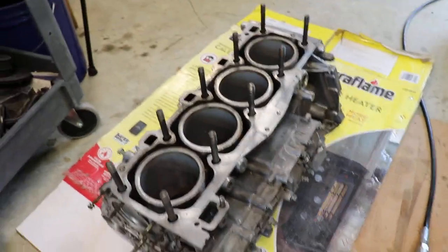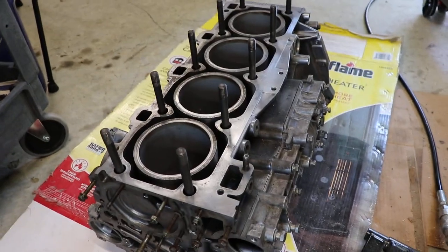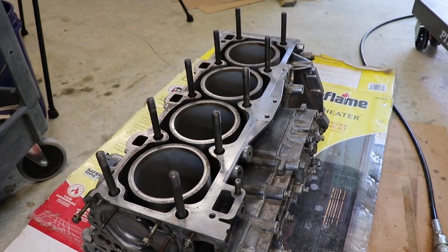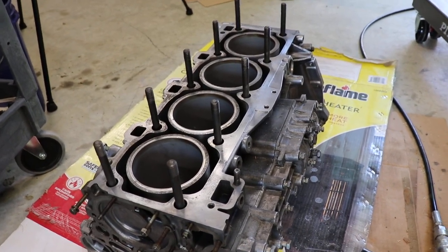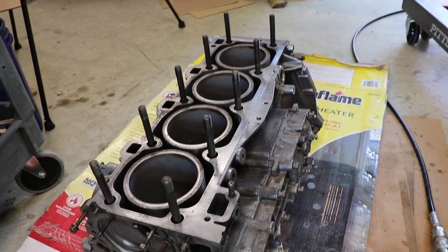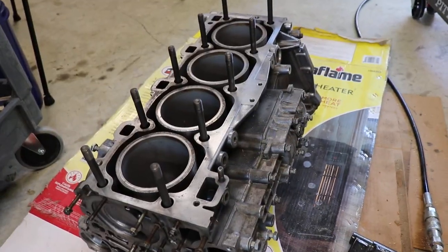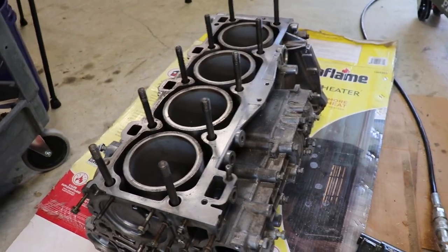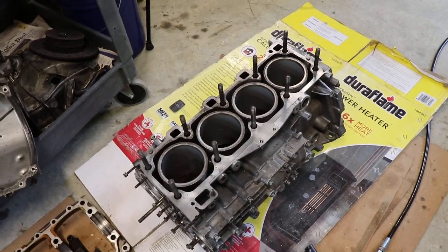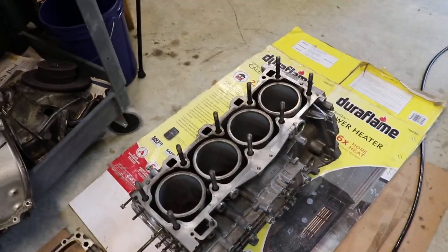And this one came with the OPV, the oil pressure relief valve, which I didn't know, but is actually different than the one for an 86. So they have the upgrade from the 3-piece from 82 through the 86. Then they have a different one for the 87 and on. So that came with the valve, and mine, I did the upgrade on mine for the 6R oil cooler housing and the oil pressure relief valve, which is about over a $400 part, which, let me see if I can find those real quick.